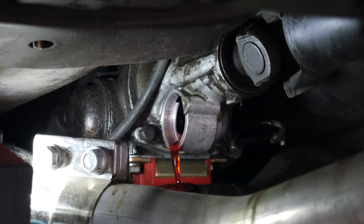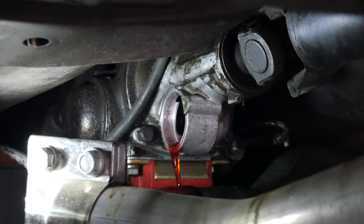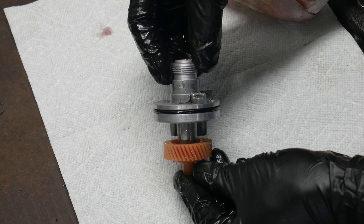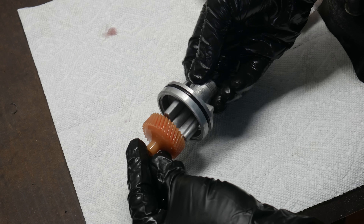The next step is to remove the clamp hold-down bolt — it's a small bolt threaded into aluminum, so we have to be careful. Once loosened, we remove the bolt and the hold-down clamp. Now the only thing holding in the housing is the friction from the o-ring seal around its perimeter. Despite not being held in by much, it didn't drop free. We grabbed the housing with channel locks and rotated, pulled, and pried it loose — but don't put too much force on it; it should come straight out. Be ready to catch a little fluid behind it.